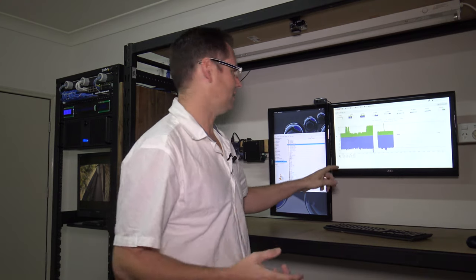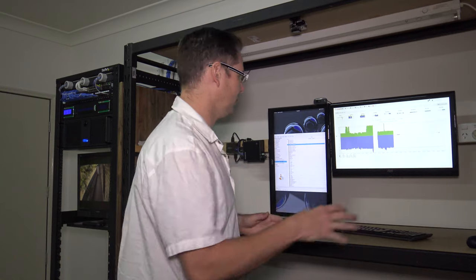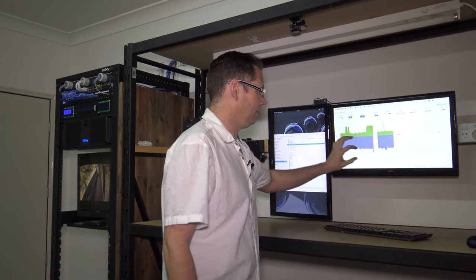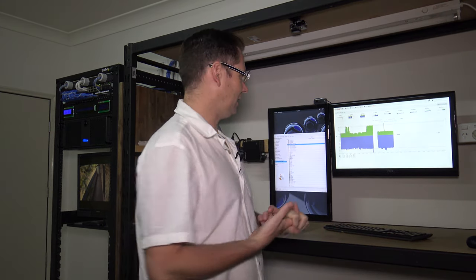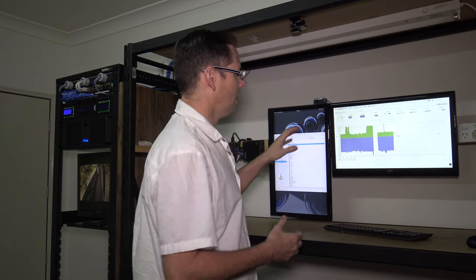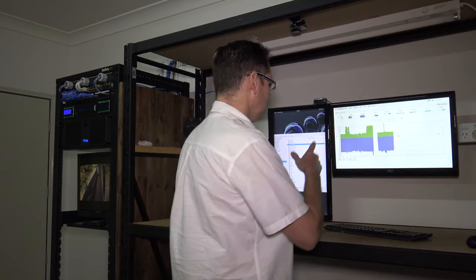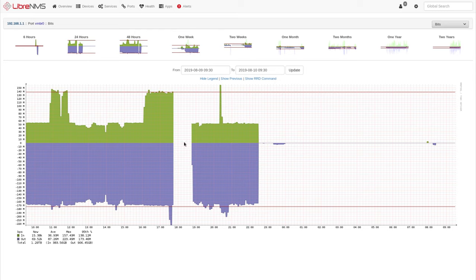Going out from the server is a lot more — that's because I'm using VLC to get the RTSP stream coming into the computer, rewrapping it as multicast, and sending it out as multicast. So that same data coming in goes out again as multicast, and the rest is made up from the TV servers — just over 100 meg combined. So TV servers plus camera outgoing is about 160 meg — the server's network interface is hit with 60 meg in and about 170 out. This big gap here is when I shut it down to do the physical cabling, which took about an hour.